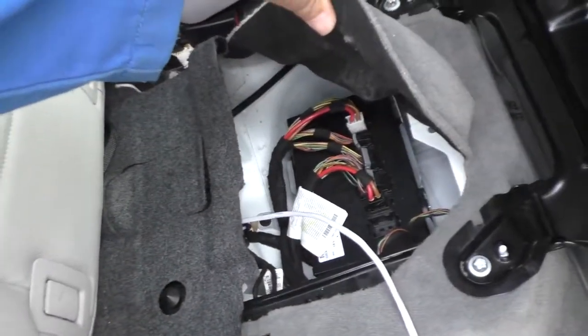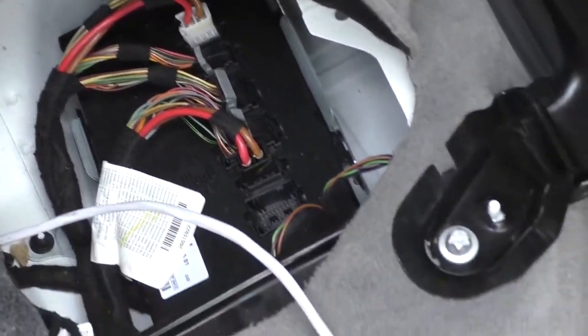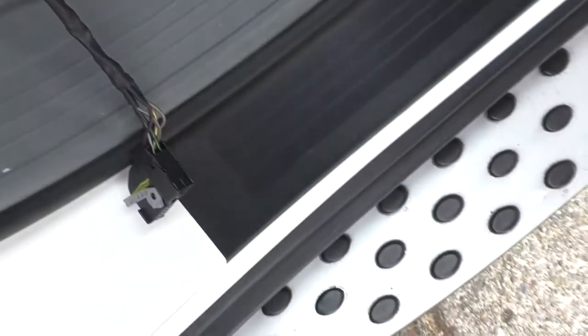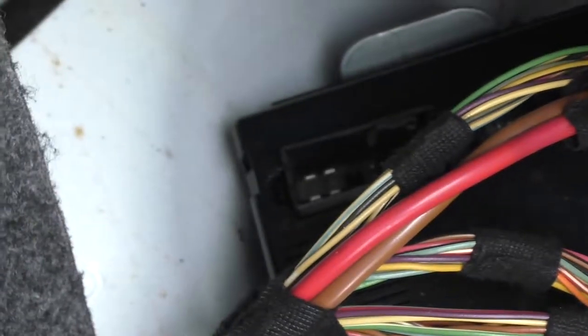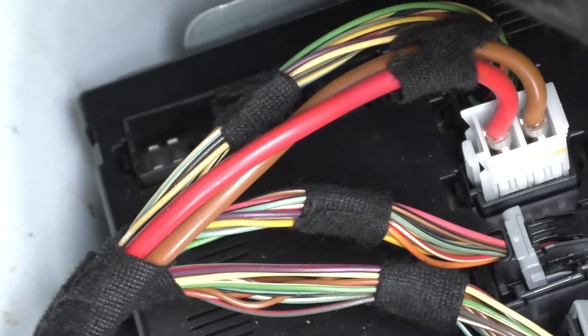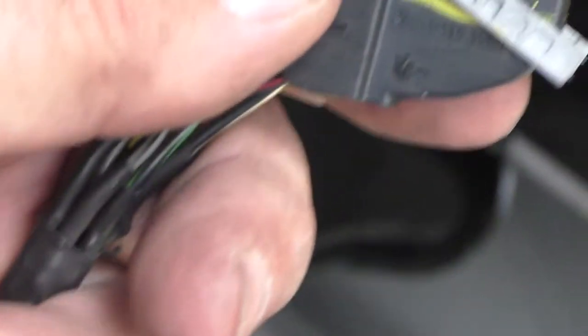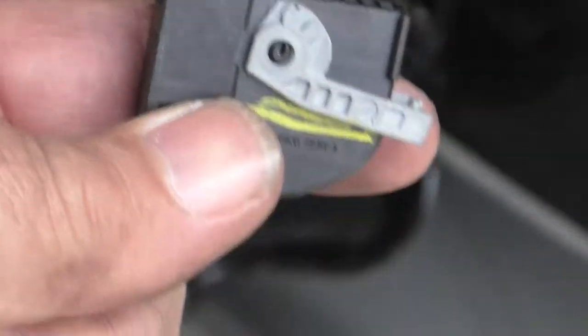Here we are inside the vehicle where the status signal acquisition module is with the connector. And we're going to plug in right here into connector N15. And then flip down the little pivoting lock lever that's on the, this is a lock mechanism. Once you get it in, you flip it shut to retain it.